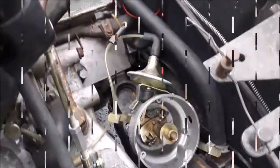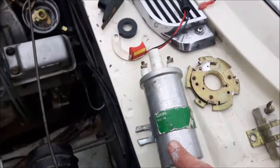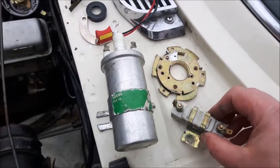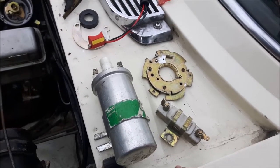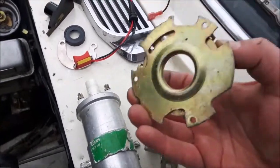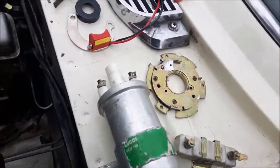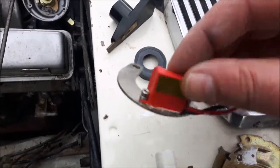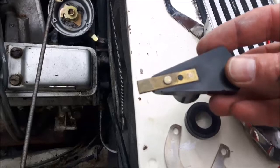The only way forward, so now I'll remove all the bits we don't need. We've got the basic distributor shell. We've taken out the old six-volt coil and its ballast resistor — ballast resistors are fitted on these older cars because the starter motor steals all the current and doesn't leave enough for the distributor. Taking out the very rare and valuable Triumph Lucas base plate — I'm going to keep that. We're taking out the PowerSpark module and the magnet.